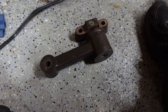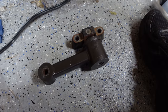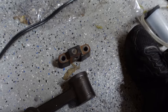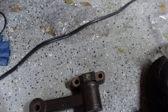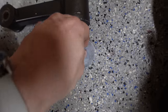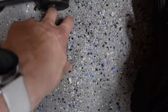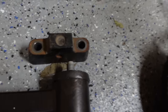More content opportunities I guess. Hey, it's Jake from a few days later when I was editing this video — turns out I did this a bit wrong. Since I got these used I never really looked at the official materials from the manufacturer. It turns out I installed these a bit wrong. This one is from the top and I saw the witness marks from it being installed like this, but it turns out that is wrong. What you're actually supposed to do is take this bracket, flip it around, then reattach it and reinstall. Also you're going to want washers that go over here like this.